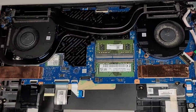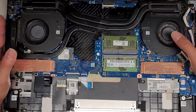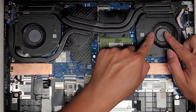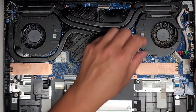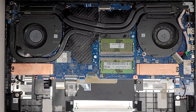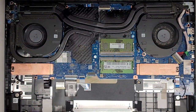I'm going to show what's in here — I'm not going to take everything out because the only issue is with the screen. I'm going to clean this dust out with a toothbrush and then use a powerful electric air blower to get the dust out. I don't like using cans because they blow really cold air and can cause condensation to damage other components.